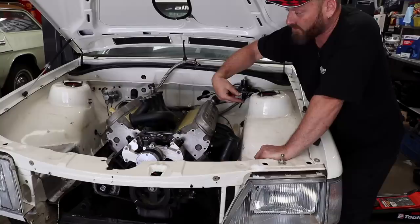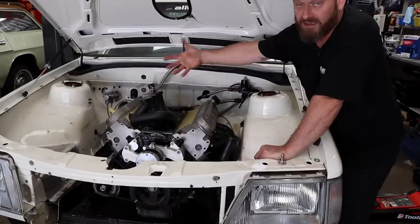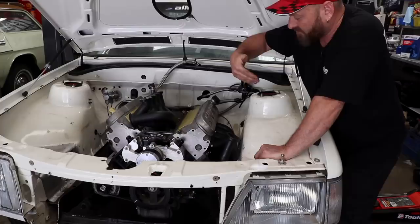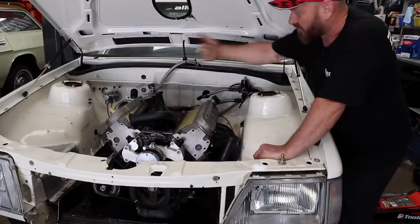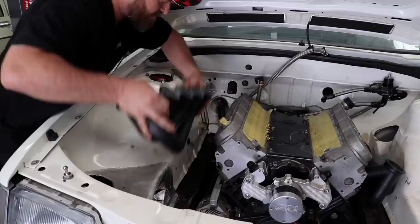The engines are actually mounted further over to one side with the mount kits they do for these, because normally they're naturally aspirated with extractors and the steering rack is in the way on the other side — so the kit offsets the engine to give more space around the steering rack. You don't need that when it's got turbos, but it's already mounted so we're not going to change it. The other side will go on fine with six studs.